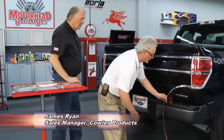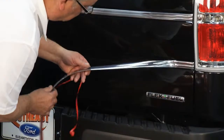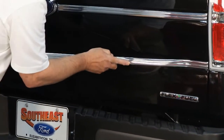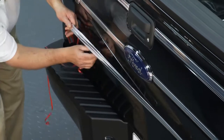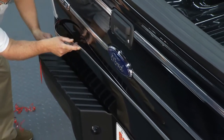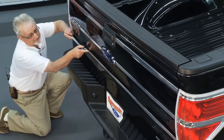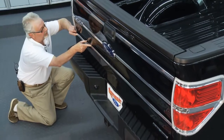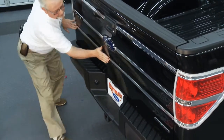Okay, well, I'm going to remove the liner off the back of this. It's 3M liner. This is easy to install too, by the way, isn't it? Absolutely. And just pull the liner off. Now, the key on this is to keep it nice and taut. Yes, nice and taut, and get your liner off. Then you look down the line and basically just lay it right into the groove, just like that, and then press it in.